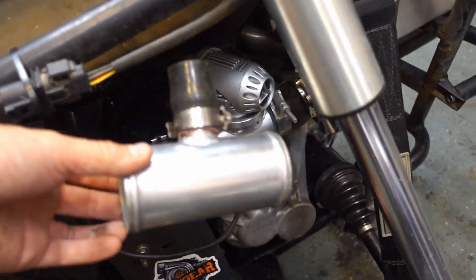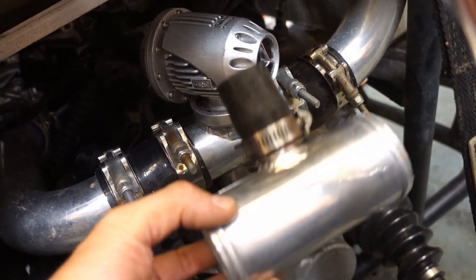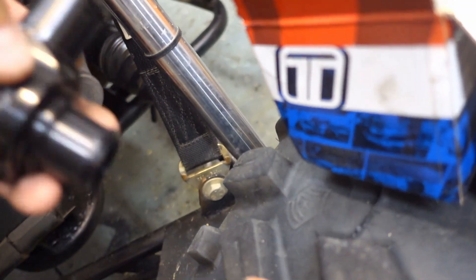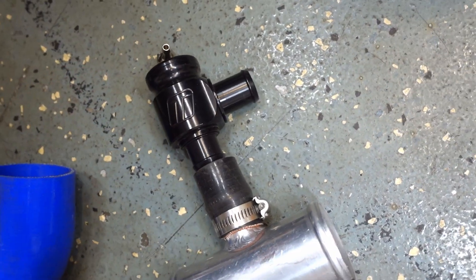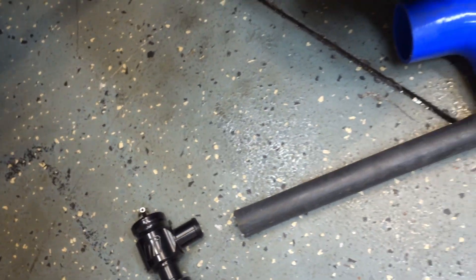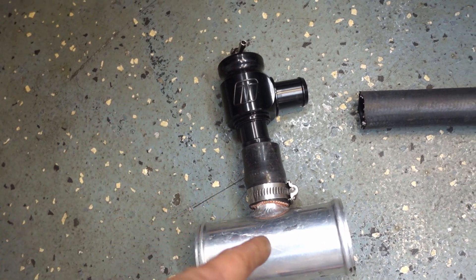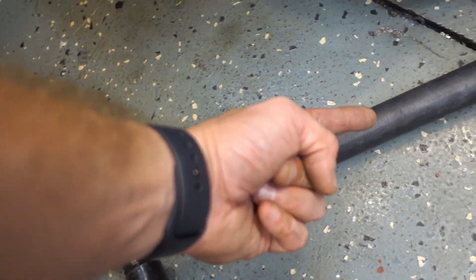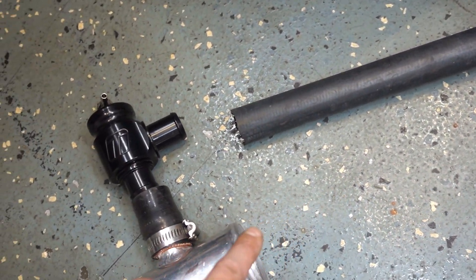Here's my plan. I'm going to replace this section of pipe that goes to our blow-off valve with one that's got a fitting on it — I think that is just a one inch or 25 millimeter adapter. Our Turbosmart blow-off valve will connect here to this charge pipe, and then we'll run a piece of one inch hose to the other side of the turbo, to our intake charge piping. So when that throttle plate shuts, our boost pressure gets routed up into the Turbosmart and it sends 100% of that vented pressure back along this tubing, through the turbo, through the charge pipe and intercooler, back through to this pipe.